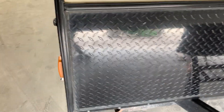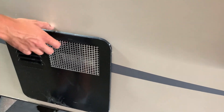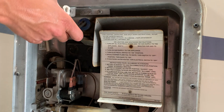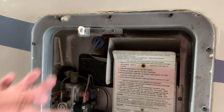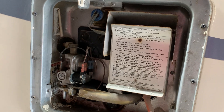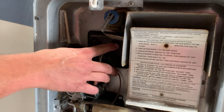It does have a manual front jack. There's just more storage up front here. Right here is where you're going to find your water heater. Before you ever fire up your water heater you're just going to want to give this little pressure relief valve a pull. If the tank was full you would see a little shot of water come out letting you know it's full. You're not going to want to fire it if it's empty — you do run the risk of burning out any probes. While we're inside I'll go over the reset procedure — the button I'm referring to is just right here.